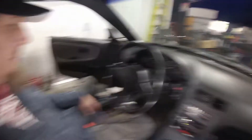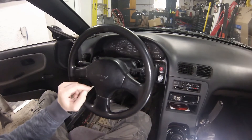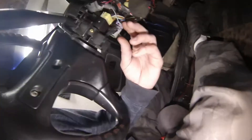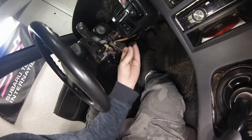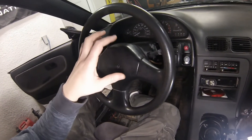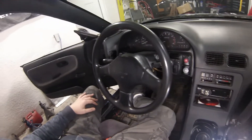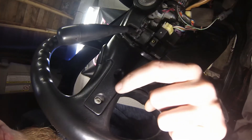Sitting inside the car now — it's got an old-style steering wheel with no airbag, so I don't have to worry about that. The horn does work, and I've found this connector right here. Give it a little push and pull — that's for the horn. So I should be able to wire this off to another switch quite easily, and not have to worry about that cheap horn ring getting cockeyed and just blasting off when I don't want it to.